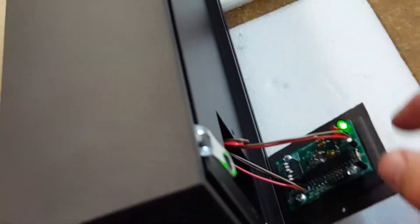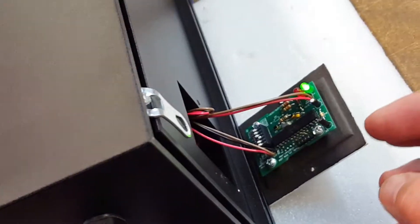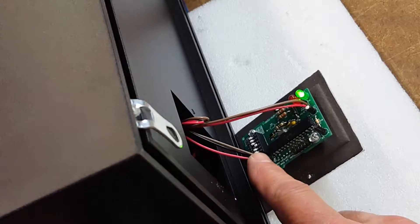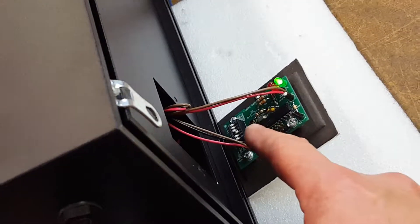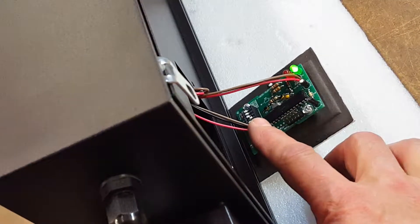I'll move my camera. You remove two screws and there's a plate on the back side. There are dip switches that you can set for your time zone, 12 or 24 hour mode, and daylight savings enable.